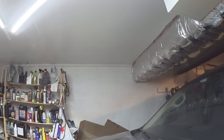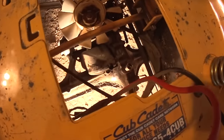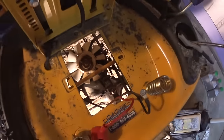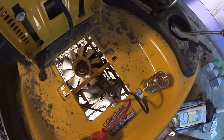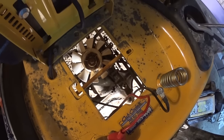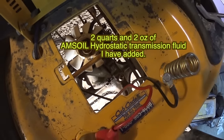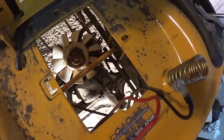All tools and products used in the video will be in the description — you can purchase the pump, the vacuum, the fluid, and everything else I used. I'm putting the plug back and vacuuming up the few oil drops that spilled when I removed the funnel. This is how simple it is — the longest part is extracting the fluid because it's so thick. If you can warm it up first by driving around, extraction will be easier, but it still works cold at around 72-74 degrees. Thanks for watching — click the bell, subscribe, and if you have questions, ask me.